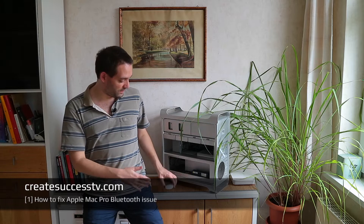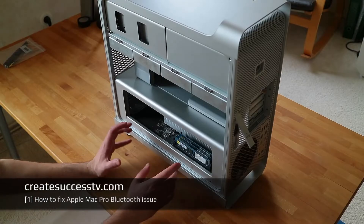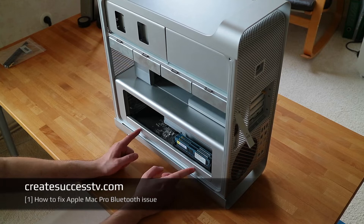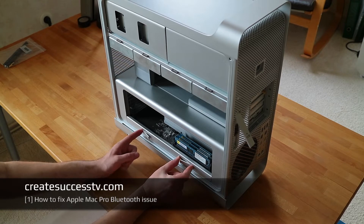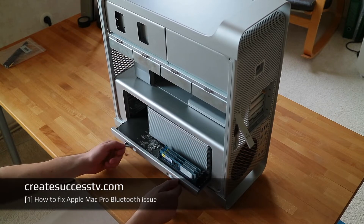Since you've clicked on part 1, you're probably experiencing the same Bluetooth issue. It's a really simple fix - we're just going to quickly take out the tray and replace the stock Bluetooth antenna with another one. I'll show you where the Bluetooth module is and how to install it. First, I'm going to remove this tray down here where the memory and CPU are, so I can access the Bluetooth module which is just behind there.